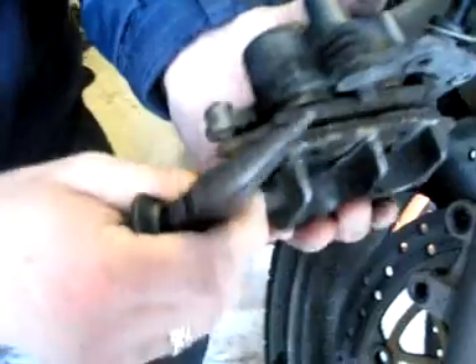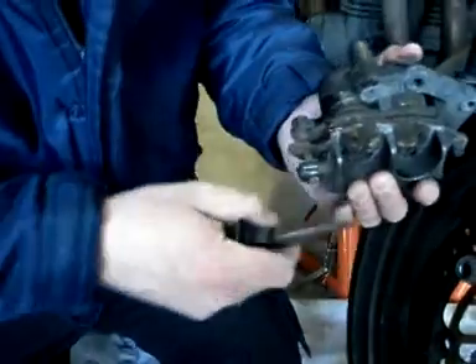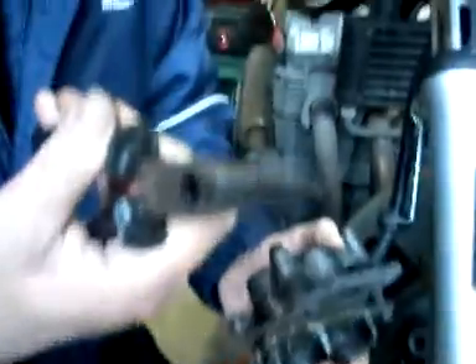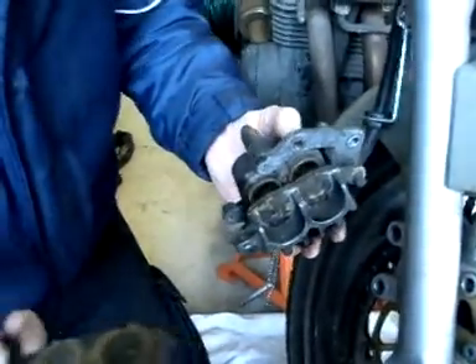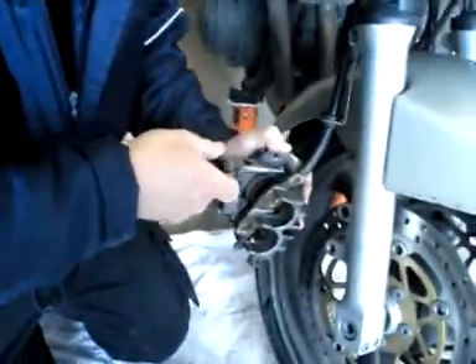This particular model uses a small, tiny little cotter pin just here, so we need to take that out. There's a bit of clearance — grab it with the pliers, pull it out. It goes in the parts tub; everything we take off goes in the tub so we know where it is. The pin comes out into the parts tub, and that leaves us free to take out the pads. You can see those are pretty worn pads — that's the other pad.